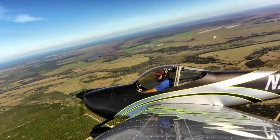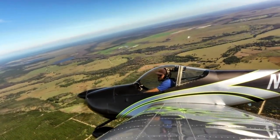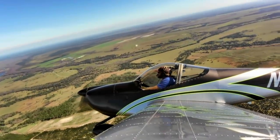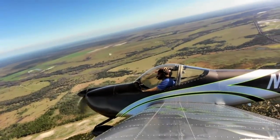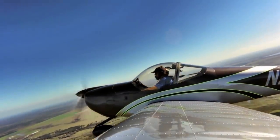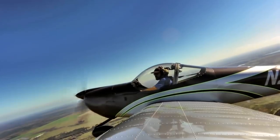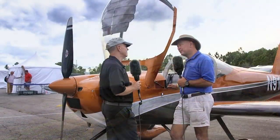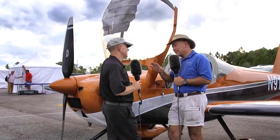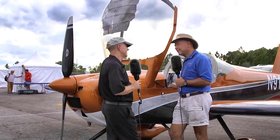We have electric flaps. I think they fully deploy in about 2.5 seconds. So there's no delay. To what degrees? 24 degrees. It's marked on the EFIS at 12 and then 24 degrees. So usually I'll set up full flaps for landing, and it comes right down at 60 knots. It's got an angle of attack, beep, beep, beep, kind of audio for you, and you fly that all the way down final. And if you fly that right, when those wheels smack, you're out of airspeed.